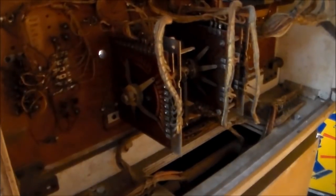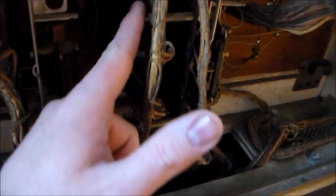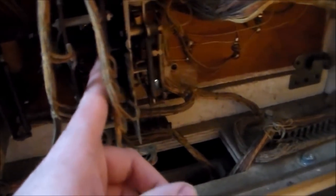We'll go ahead and clean this one up — the zero-to-nine unit. Then we'll get over here to this player control unit. That one's going to be a little more complicated. This one was really easy to do because you can just get to all of the contacts, so I was able to clean them, turn it a little bit using the things, and put a little bit of grease on it. I didn't actually have to take the spindle all the way out because it's turning really good. And then this is the big player control unit — it's a double level one. I'm going to take it loose, get it out here where I can look at it, take the top spider off, then the top board off, and then the other spider so I can get down to that board and clean it.